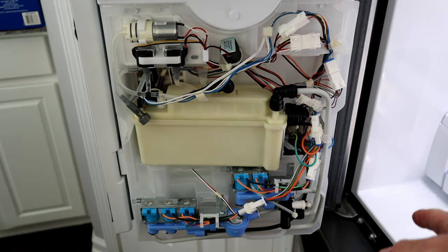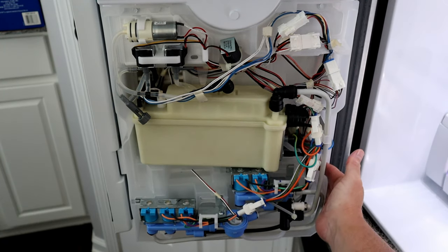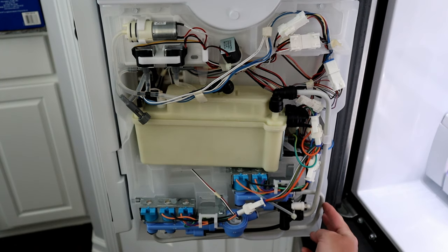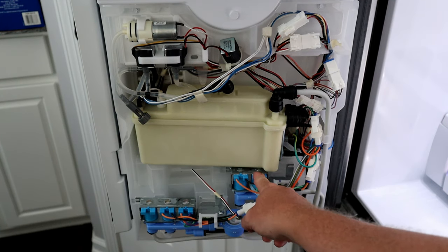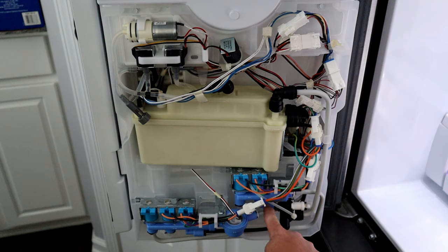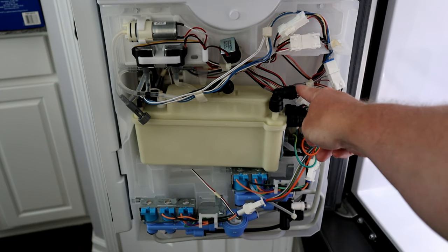Let me walk through the flow of water through these valves. On the front of the door when you press the start heating button, the main circuit board talks through the feature board down below, and that feature board activates the flow of water and turns on the hot water heater element in this tank. The water line from the isolation valve connects here to a flow meter, and the water then exits. These two valves are closed normally, so the water goes straight through and comes out this tube down here, which wraps around and enters this double valve. This valve on the right is the control for the Keurig, and it exits through this flow meter here — the water comes up this tube out of the flow meter and into the tank.